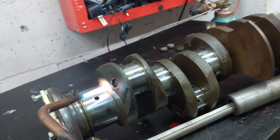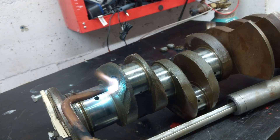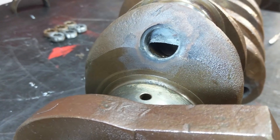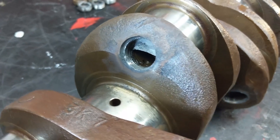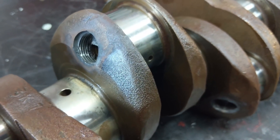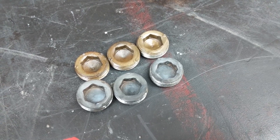I'm going to try heating up these plugs. They don't seem to get red hot very easily but they can get warm — maybe that counterweight is acting as a heat sink. Here's the reason why we took these plugs out: you can see this one is halfway filled with some sort of residue from the old oils. It's really important to get this out because this area is the connection point between two bearing surfaces. If it filled up or loosened into one of these small oil passages, we'd have no lubrication on the connecting rod — that would be a big mess. Looking at the plugs, we needed to heat up three of the six, and will probably renew them and get new ones once we've cleaned it all up.